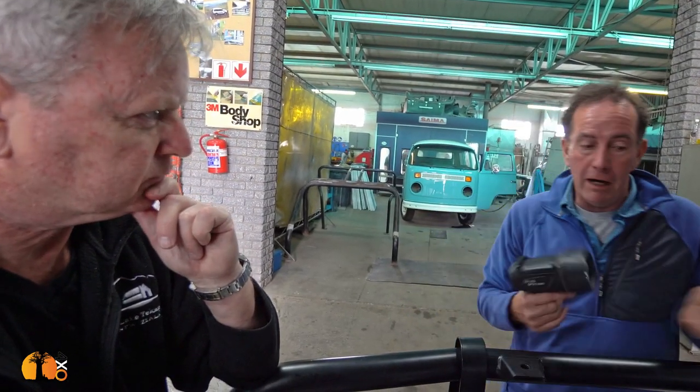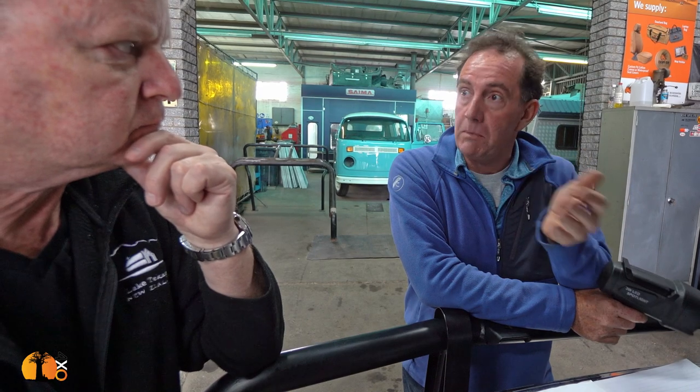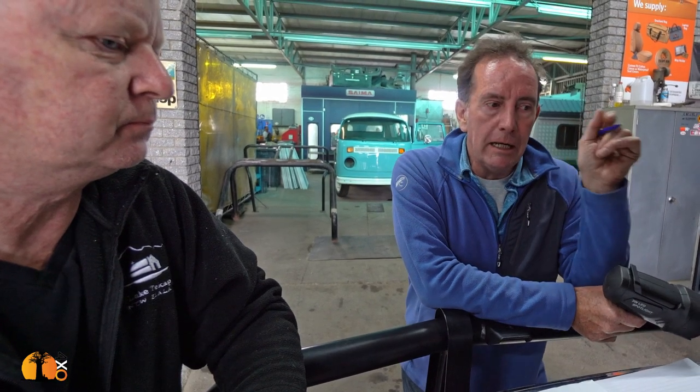You've got a bull bar on here, that's fine. But what I don't like seeing is big spotlights in the front — especially on these sort of cars — because we've worked on that before and know how much that impacts on engines overheating. The drive is a critical element. Most times when people look for a car they don't take it for a long enough drive. If you haven't got someone like a specialist to check the car, take it to Toyota. Let them go through it. Do a compression test on the engine — that's going to tell you something.